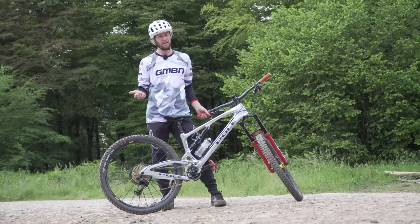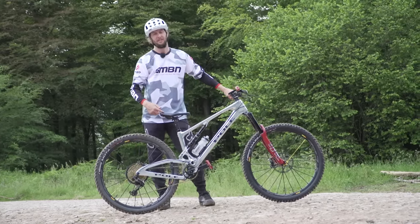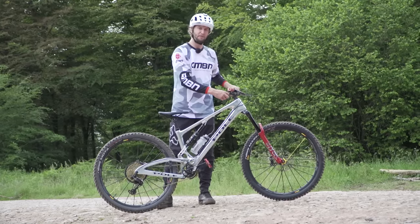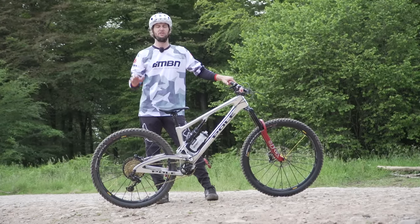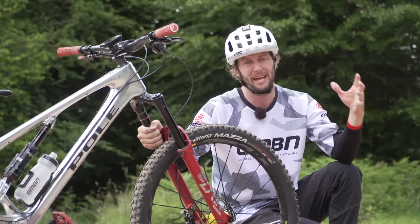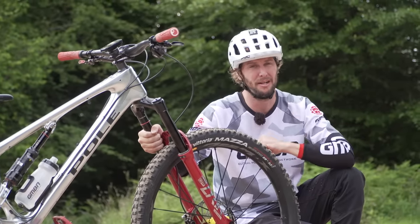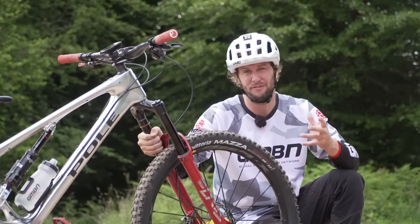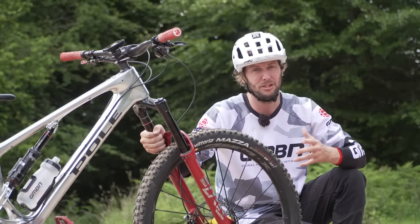The basic M-Check is a good place to start. You would start at the back, then work your way up to around the seat, down to the bottom bracket, up and around the headset, and then down towards the front brake — that way you can go over most of the essential moving parts. Once you've got to grips with the basic M-Check and you're feeling adventurous, you might want to start learning something more in depth, like how the gears work, and if you're feeling really brave, advanced mechanics like how to bleed your brakes.